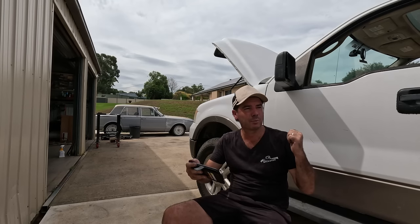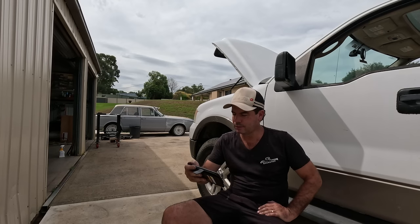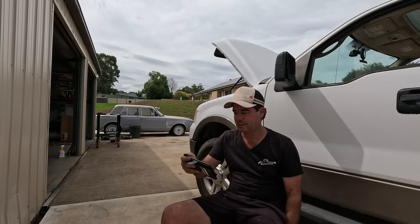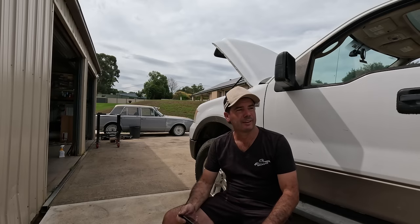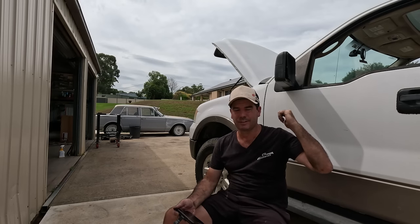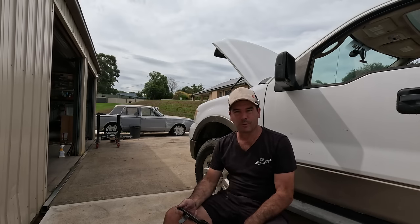If you remember, the AC compressor in this one failed. Oxygen sensors number 11 to 21, whatever. CMCV, mass airflow sensor, heated positive crankcase ventilation, or PCV, which that kind of is as well. So my point being, both of those O2 sensor codes and that evaporative emissions circuit code, all controlled by the one fuse.